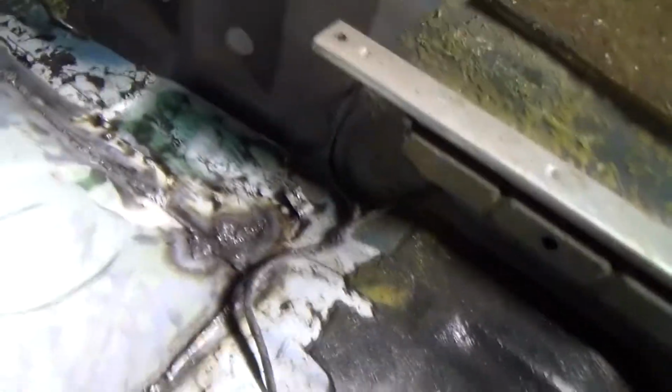Well, it's been on there for about half an hour now. I don't know if you can see the finish on that actually. It's actually gone quite grey. It's gone grey and dull. So it's obviously doing something, which is probably quite good. It's etching into it, I suppose. I think what I'm going to do now is get the water and rinse it all down, top side and bottom. And then give it all a wipe down. And then it'll be ready for our POR-15 paint, which would be good. Okay, so on to the next step.